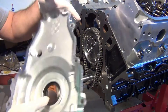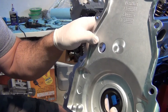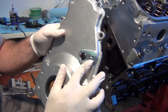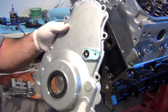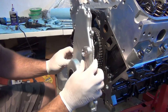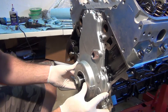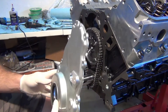We got it all cleaned up. You can see right there — shaved it down, nice and smooth, nice gap there, didn't go all the way down to the threads. Just remember, this doesn't have to be torqued that much, so it's not like you have to have a lot of meat there for that screw. There's lots of room for the chain to move in there, not right up against the chain. We're going to pull this off, tape it all up, get it ready for paint.